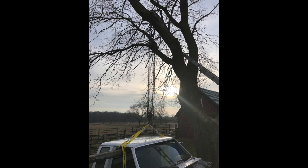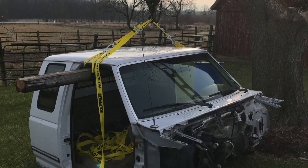What I did was take my chain hoist out to the backyard and find a tree with a big enough branch — probably about a foot and a half in diameter. I tried to attach the hoist as close to the center of the tree as I could, because I didn't want the weight out at the end of the branch where there's a chance it could snap. If you've got a big enough tree in your backyard, you can put that chain hoist up there and it's more than strong enough to hold 400 to 500 pounds.